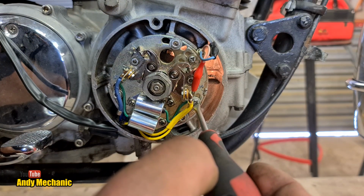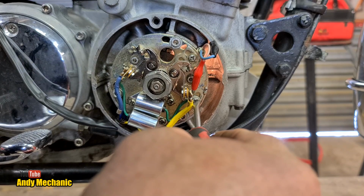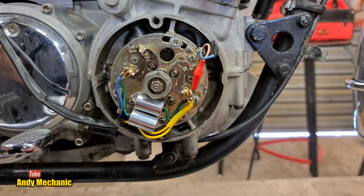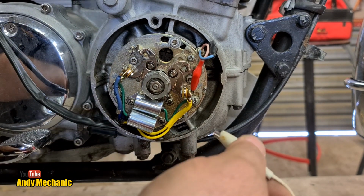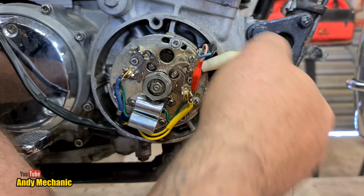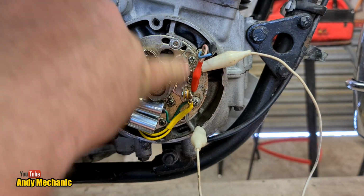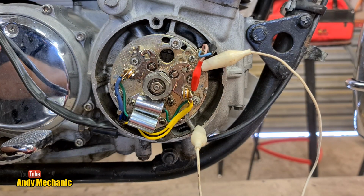Okay, we've got these 2 pretty mangled screws going on now. I've got one here, so I'm just going to slacken that one off, if I can. There we go. And the other one. Now, with this being on a secondary subplate, I'm going to give it a good ground. So I'm going to put a test lead just off the back there, out of the way, and then down onto the engine casing, just to eliminate any possibility of poor conductivity whilst those screws are undone, because it relies on those screws to give it the circuit, and of course we've just slackened them off.